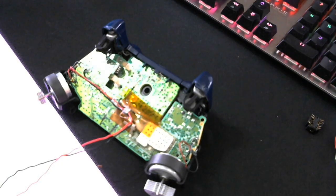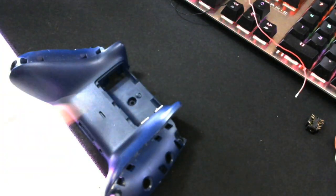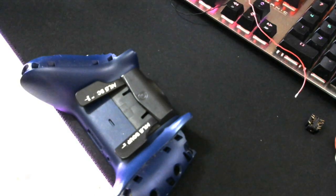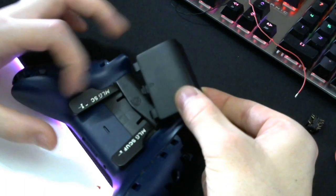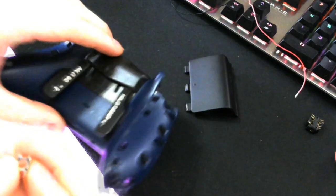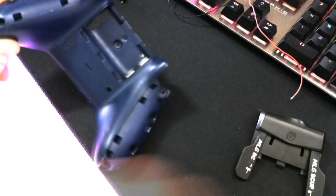Once you're at this stage with cables soldered to the board and tucked along nicely, set this part aside. Now begin to drill your holes in your back plate. If you're using your original battery plate, you're basically replicating two plastic paddles that screw into the back and come down, allowing you to use a push momentary tack switch once a hole is drilled. I've now drilled two smaller holes - I put the back of the controller on with the paddles, marked where the standoffs touched the board, and drilled straight through.